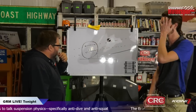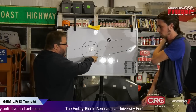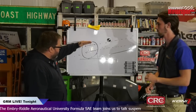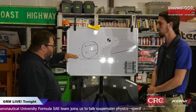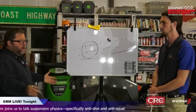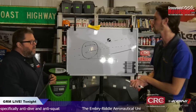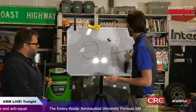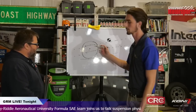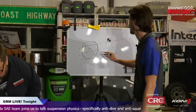If you went to a different tire diameter, it might change this angle a little bit, but this is still going to be parallel there. So if you start looking at going not parallel, where do you start? Why would you use a parallel setup first off versus intersecting? In our case, with an independent rear suspension, I actually drew this wrong. This is for a solid axle. It's the same concept, though, but this angle would start from here, as we showed everyone earlier in the book, if anyone new joined. Essentially, it's now this angle.